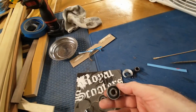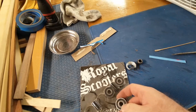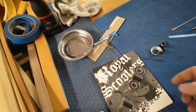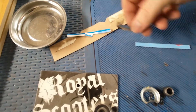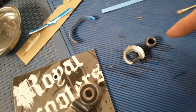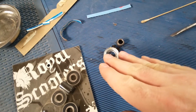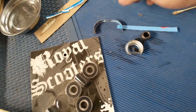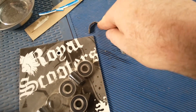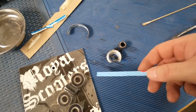I have enough bearings for two total fans with this pack. I had to make slightly taller cereal box cardboard shims, because after I took that gunk out and reduced the height of the centerpiece, there was more distance along the side for the cardboard to go. With the shorter cardboard, the bearing was pushing against it and squishing it versus going in beside it and being held properly. But again — cereal box. Everything's a resource, everything's a material, everything could work for something.